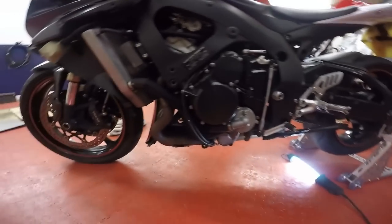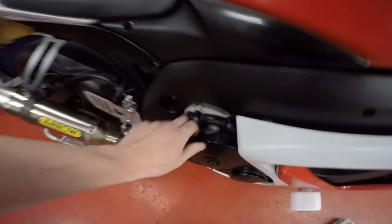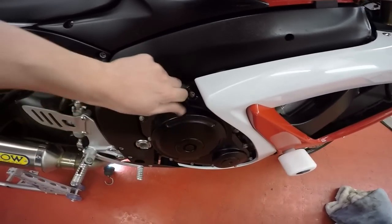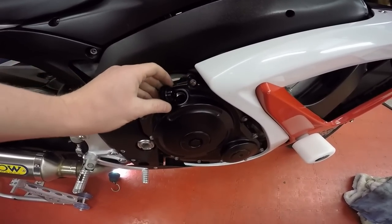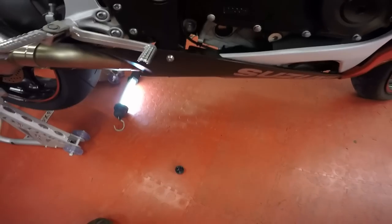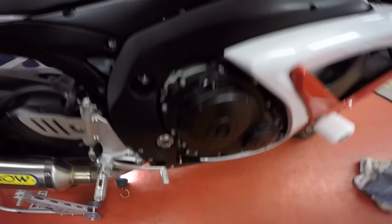This is what it looks like once you've stripped off your fairing — it only takes about 5 minutes. There are a few other bits you need to push in; it's just a little bit fiddly, but with a bit of manhandling it all comes off pretty easily. What you want to do next is drain your oil, so you want to be loosening off your filler cap. What this does is allows air to flow through the engine when you remove the sump bung, so make sure you put it somewhere safe like in your tin of parts.